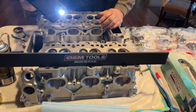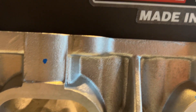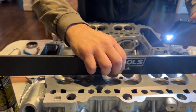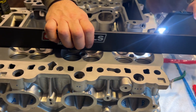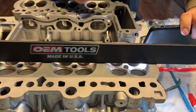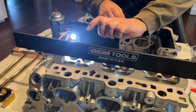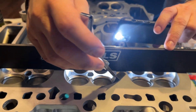We're gonna do an X across and then one straight down the middle, in a couple different spots, just to make sure we don't see any light. Of course we'll see light right here because there's a gap. How's it feel? It is looking perfect to me. So we'll just go through a few different spots on each one — basically just rinse and repeat. Of course if you can feel it rock at all, bad news. You can go and do the same thing to the block where this is going to mate, just to make sure.